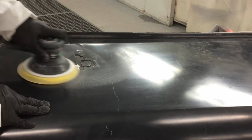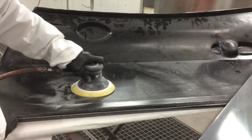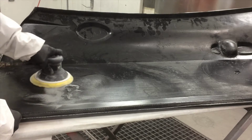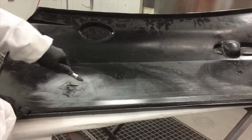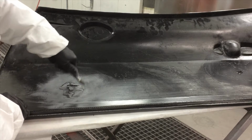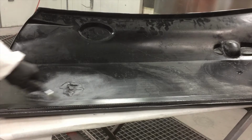After the surface area is clean, sand both the front and rear side of the panel to be repaired with 80 to 180 grit sandpaper. After the surface has been thoroughly sanded, use compressed air to blow off the repair area. To eliminate the possibility of solvent absorption by exposed fibers, do not re-clean with wax and grease remover.